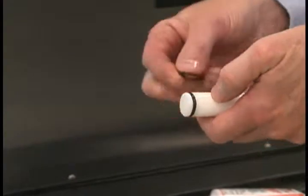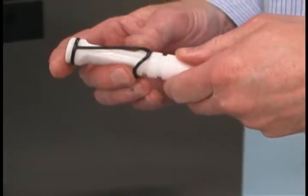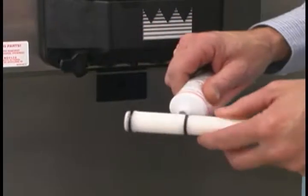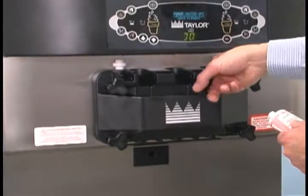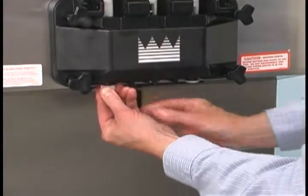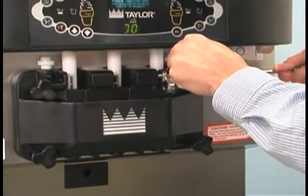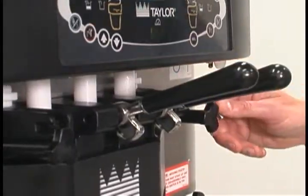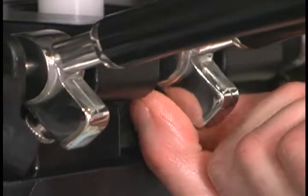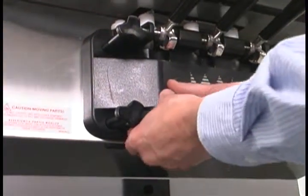Slide the three O-rings into the grooves of each standard draw valve. Slide the H-ring and the O-ring into the grooves of the center draw valve. Lubricate the H-ring and the O-rings. Lubricate the top and bottom of the inside of the freezer door spouts. Insert the draw valves from the bottom until the slot in each draw valve comes into view. Position each draw handle with the adjustment screw facing down. Slide the fork of each draw handle into the slot of each draw valve starting from the right. Slide the pivot pin through the draw handles as you insert them into the draw valves. To increase the flow rate, turn the adjustment screw clockwise. Turn the adjustment screw counter-clockwise to decrease the flow.